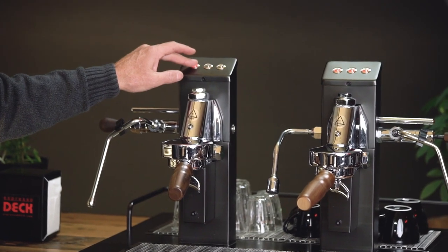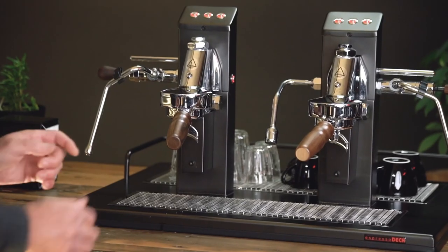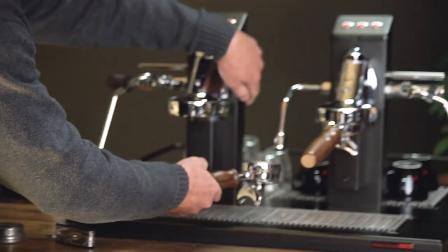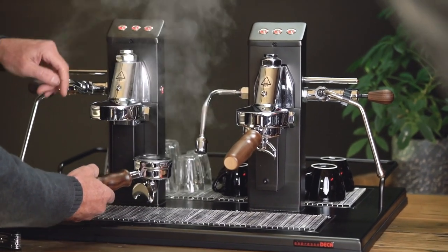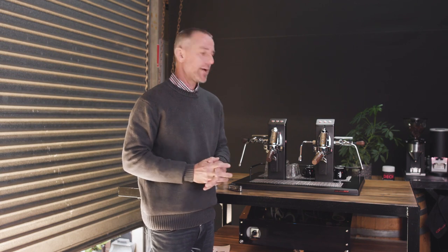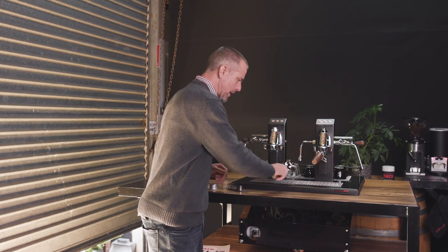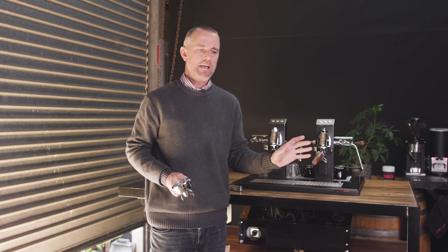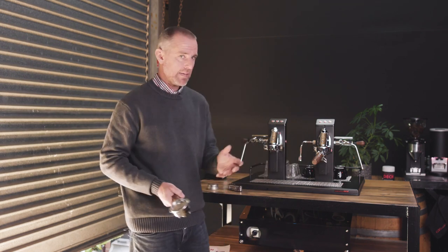If you don't hear the click, just put a little bit more water in again and lock it in, splashing water back through the valve, wetting the dried-up cleaning powder and thus freeing it all up. If that doesn't work and there is still no clicking, then you might be forced to put a little bit of cleaning powder in the blind and add the hot water. This is particularly useful if your cleaning powder has a very good foaming action — it will actually force water back through the valve and free it up that way.